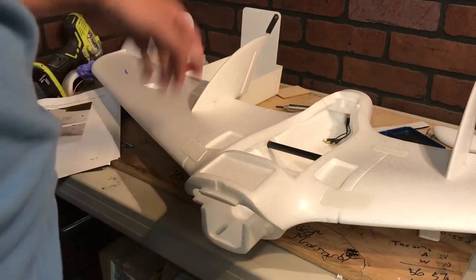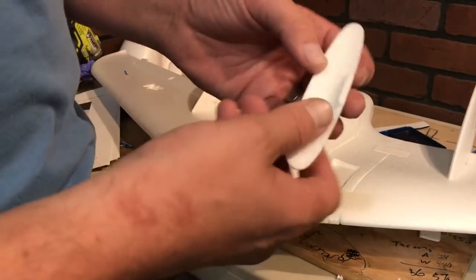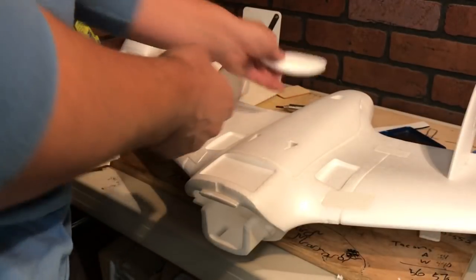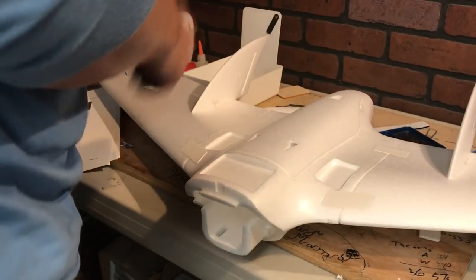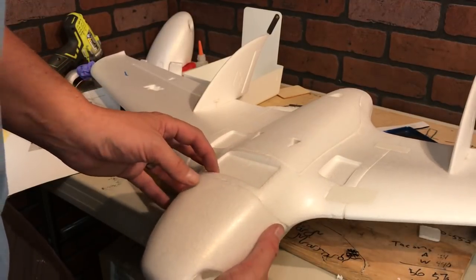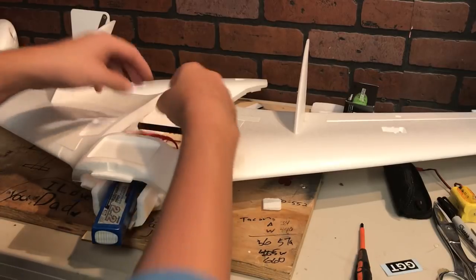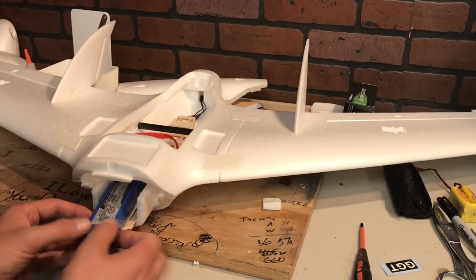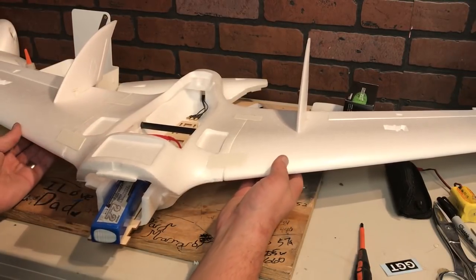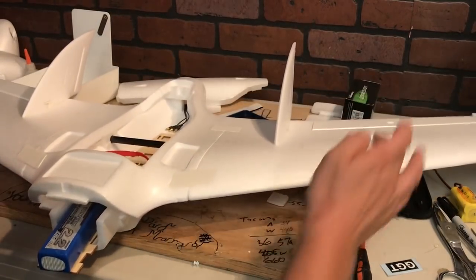There are a bunch of places for magnets that are going to hold down your front lid, and there are also skids for the bottom for landing gear. Here is the front nose cone — it just slides on like that. Battery placement is going to be up front, so I would take this parts tray and put a velcro strap up here because that's going to get the CG pretty close to the correct spot, not including the weight of the servos going into the wings.